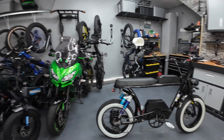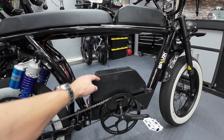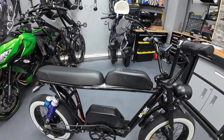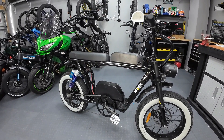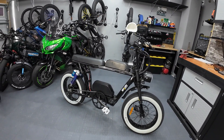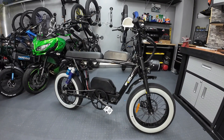This Spark Cycle Works Bandit now has the most battery pack of any bike in this garage. The one on the bottom is a 25 amp hour and this one's a 17 amp hour, both at 52 volts — that's 42 amp hours at 52 volts. That's a lot. We'll have to do a range test to see how far it'll go, but let's take it for a quick ride and see if I notice anything different. It probably won't add top speed, but I'd expect less voltage sag.